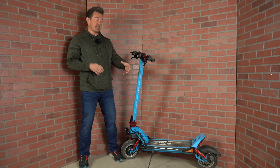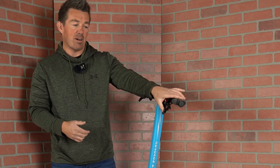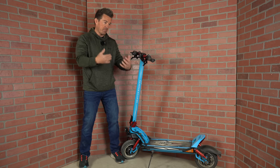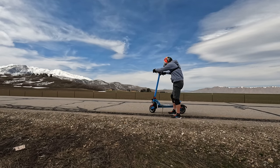There's like this sweet spot of pressure in the levers to have a nice gentle stop. It feels like the harder you squeeze, the faster those regens come on. Overall, level 5 was too abrupt for me, especially for light braking. I lowered that to level 3 and enjoyed the ride much more.